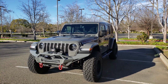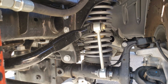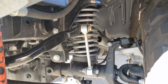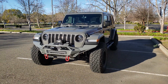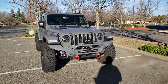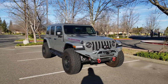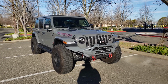Freeway, it rides great. So the only issue right now that I've been having is my spring has sunk way too much. It's not supposed to be like that anyway. It didn't used to be like that. So I tend to hit the bump stop quite often now on the most simple things. So I wish I just went with MetalCloak, and I wish I knew that maybe the Rubicon Express suspension system didn't accommodate for the extra weight of the EcoDiesel, which I asked them about. They said that it will work okay, it will work fine, but of course now it doesn't.